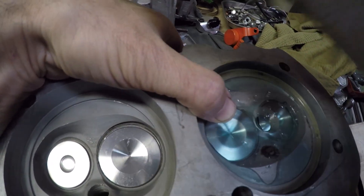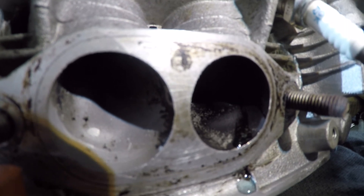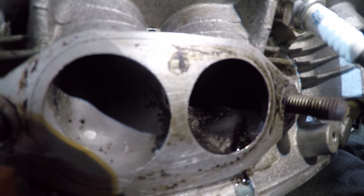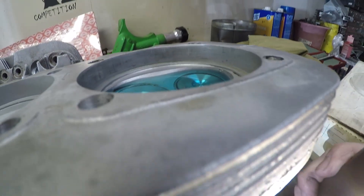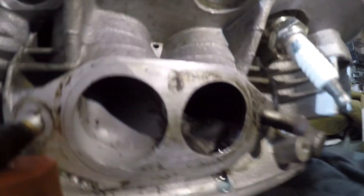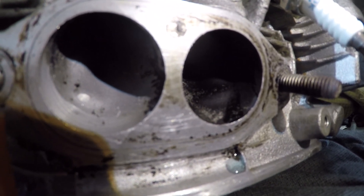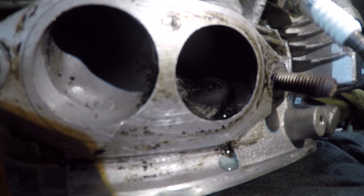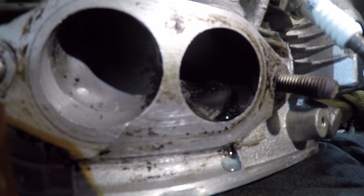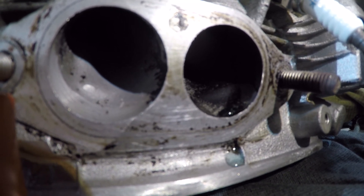The compression ratio I'm trying to reach — I'd rather have the 50 CCs versus the 48. So this is the intake, and what I did is I just filled the cylinder back up with the fluid and let it sit here. We actually got a pool of water coming out of the intake. That's telling me that intake valve is not sealing. I'm going to have to probably take a look at that. It's probably why I have 50 CCs versus 48 CCs, because I'm losing a little bit of fluid. So that needs to be addressed.